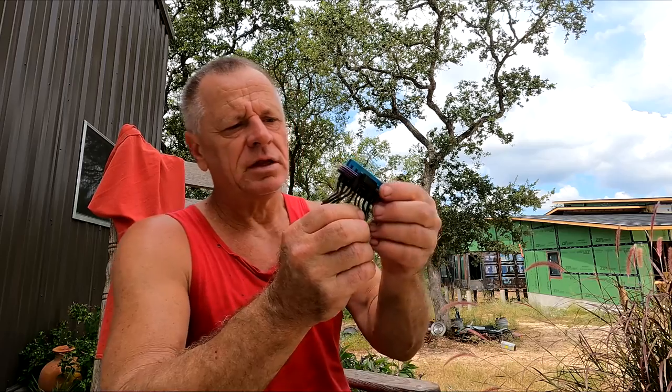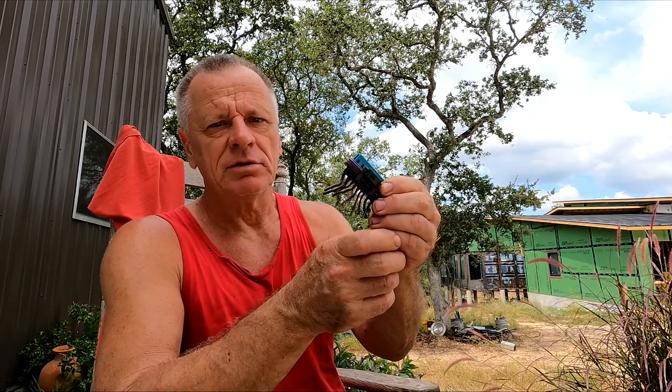Hey guys, VTech here at Blueberry Hill. Here's an episode with the F-350 — it's a 2002 F-350 with the 7.3 liter. I've been chasing all kinds of gremlins on this thing; it's been kind of a pain-in-the-ass truck. It doesn't just let me drive it — I have to constantly play with it. Sooner or later I'm going to replace everything on it. I replaced the external injector pigtail today and the truck runs awesome right now with the injector rebuild shim kit plus the new cups — it's running super smooth.